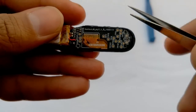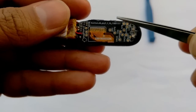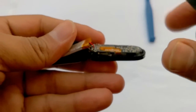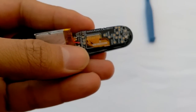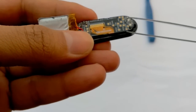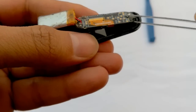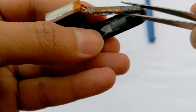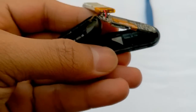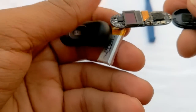So this is all about the PCB board. Most of the holes in the Xiaomi Mi Band 2 capsule are sealed using hot glue which provides water resistance capacity, and that's why it requires some tedious cleaning jobs if we need to repair it. This PCB board can also be removed to check the OLED display. Let me remove this PCB board and we will talk about the OLED display.